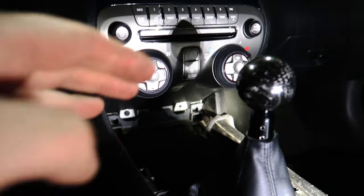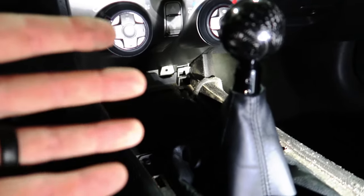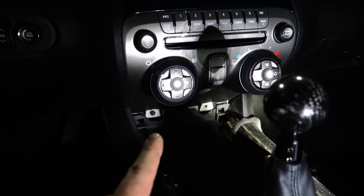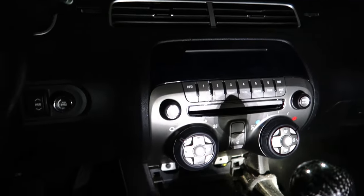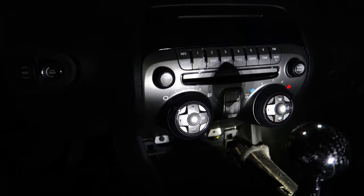So we're going to go ahead and uninstall that piece of crap that's in there and install this beauty. Removing this radio isn't too bad. You have to remove the lower gauges here, which is all clips — you can just lift it out of here and set it off to the side. You can see the wire there. And then we're going to pull these two seven millimeter bolts. I already pulled one to double check that the size was correct. I think this just pops out at the top. We'll remove that, unhook everything, and go ahead and slide in the Digital Octopus.